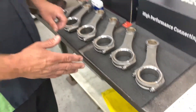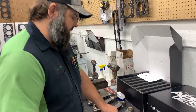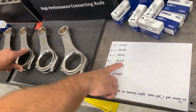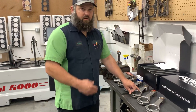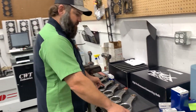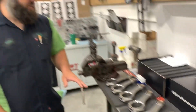So we switched out the entire set to a set of HX bearings, which is 1 thousandth extra clearance. Our 2-3 theoretically should have been 3-3, but was 4.0 — so that was a 1.7 thousandths difference going to an X bearing. The 2-4 went to 2-4 plus 1.7, so almost 2 thousandths difference changing from a standard bearing to an X bearing.